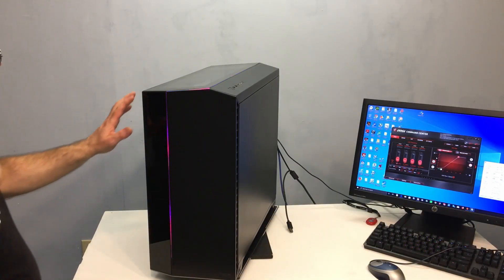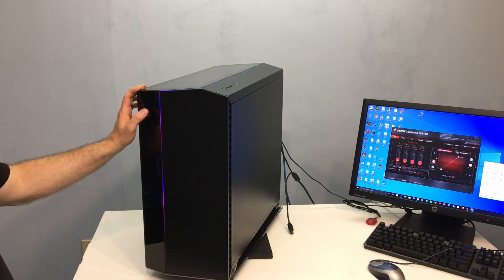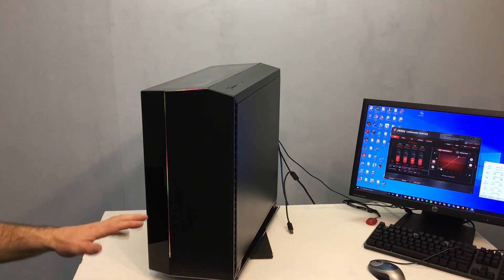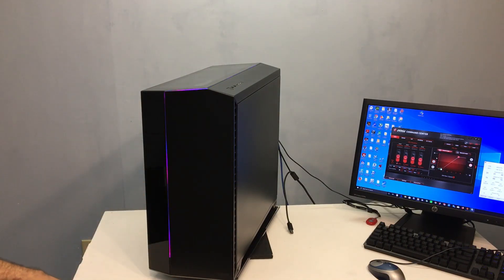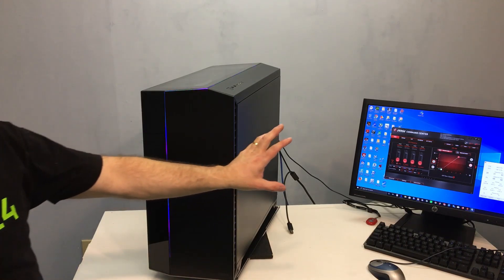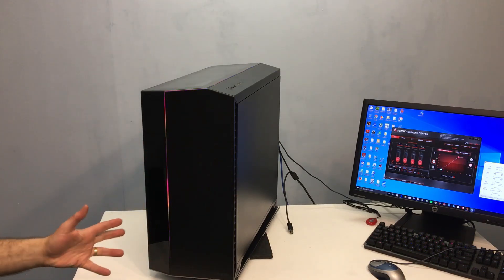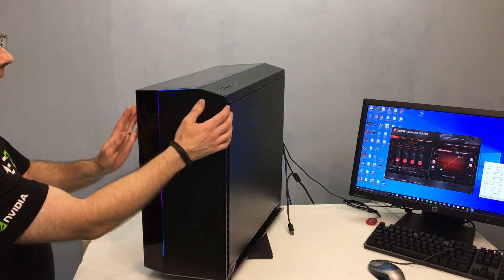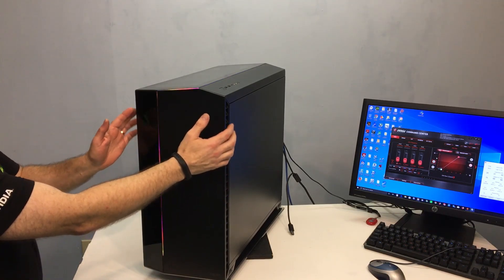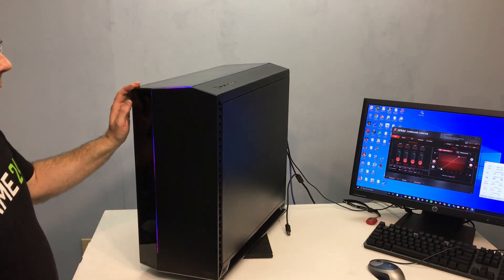The system is set up with a Z87 motherboard and a 4770K CPU, no overclock, running at idle around 29-31 degrees C. I'm looking at fan RPMs but for whatever reason I'm not getting RPM feedback — I can control fan speed through the software but just can't see the RPMs right now. Even at idle I can feel air being pulled in through the side vents at the intake. The first thing we'll do is look at thermal imaging of the case at idle.